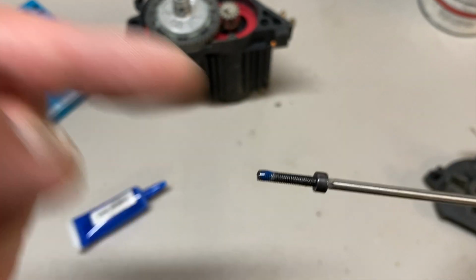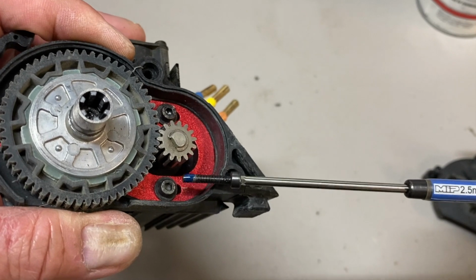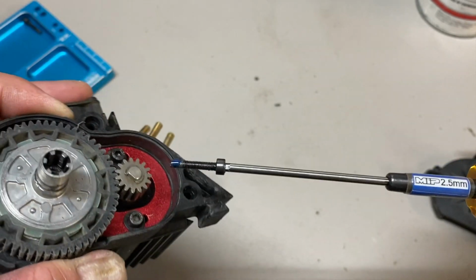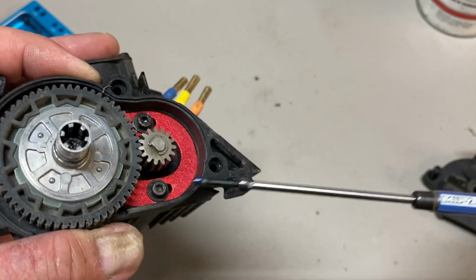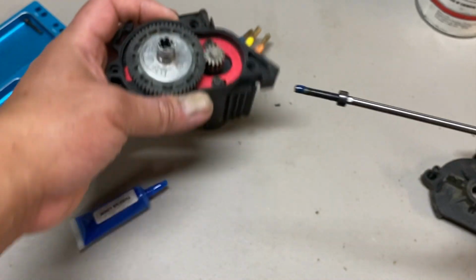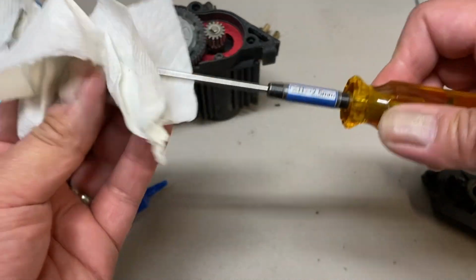And then since you put it on one side, when you thread it in through the motor plate, just go lengthwise like that, so you still got that gap. Because if you put it in like this, you'd probably scrape off all that thread lock all along the motor plate rather than get through into the actual motor itself. So yeah, there's a little tip there. So I'm going to clean that off because I'm not actually going to install this screw.